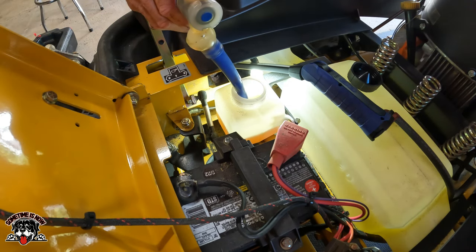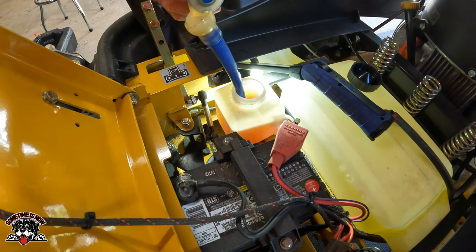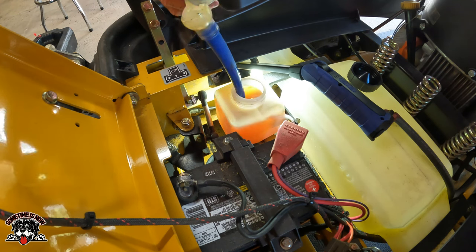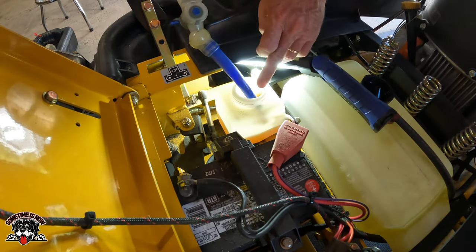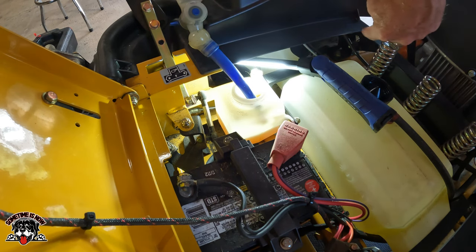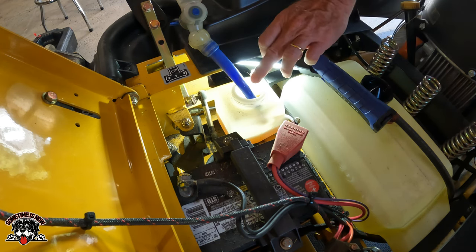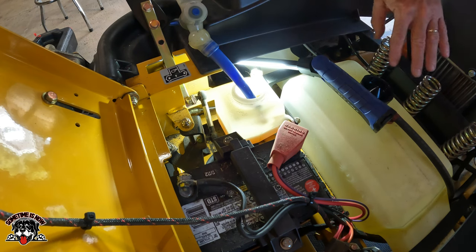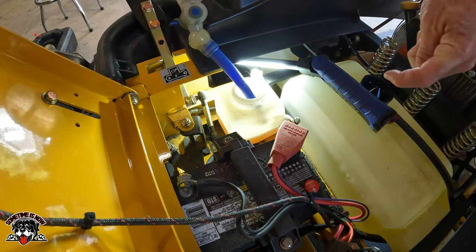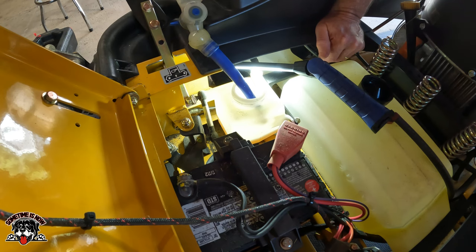This will be 3 quarts right here. That should put us close to where we gotta put the vent plugs in. Okay, so this is a total of 3 quarts that's draining down. After this, we'll look underneath, make sure there's still nothing coming out the two vent plug holes, and then we'll put another half a quart in, check it again, and then probably that's where I'm going to stick something inside one of those to see how far the oil is below those vent plugs. Slowly going down.